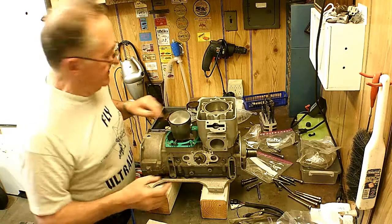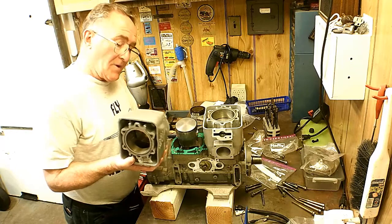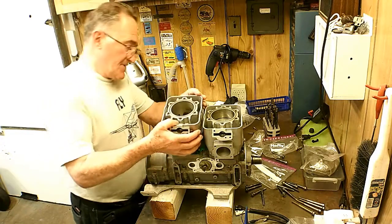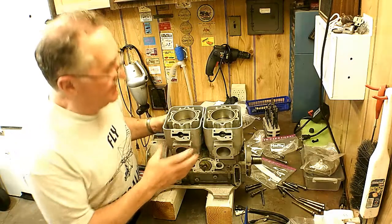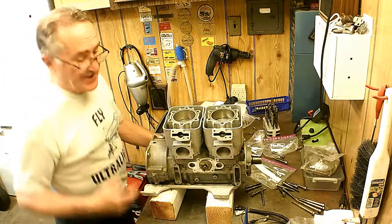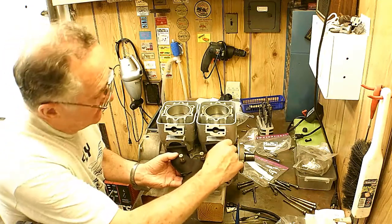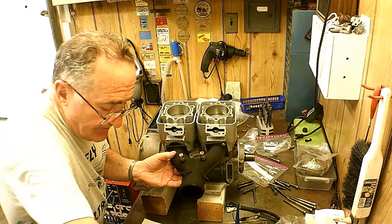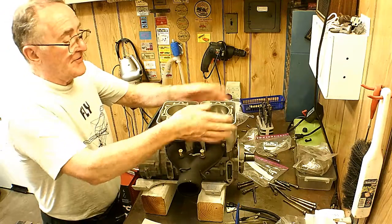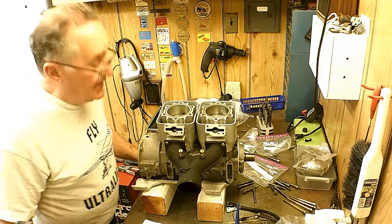Alright, now I'm ready to do the other one. Same thing on this one — got everything oiled up, nice coating on there. Grab the piston ring on each side, kind of squeeze it together, kind of jiggle your cylinder and down it goes. So it's pretty easy to do. Now I'm going to go ahead and get my exhaust manifold and clamp it on there loosely. I'm not putting any gasket in there — this is just a temporary thing here. Trying to put this on and just snug those up a little bit so it holds these cylinders square for me — they can't twist, because there's clearance in those holes.